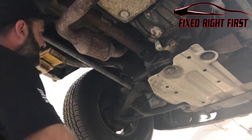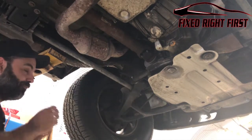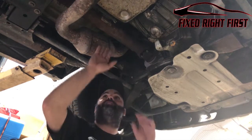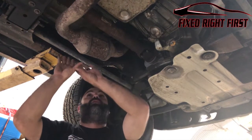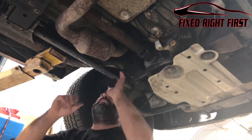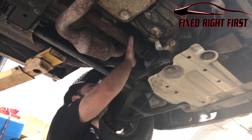This is your catalytic converter — it gets very hot in a very short amount of time. We have to remove the front driveshaft here and it's right next to this converter. I didn't drive it far, just from right outside, and I'm still not going to touch it. If you barely touch it it's going to burn you, so make sure that's cooled down before you start doing this job.